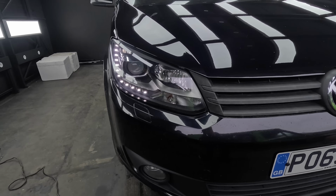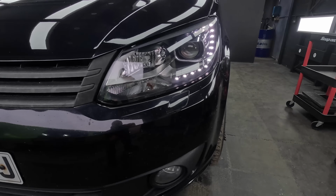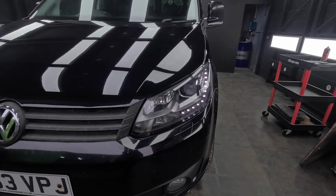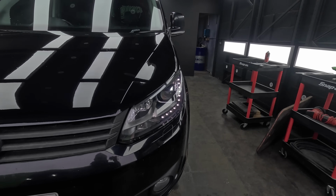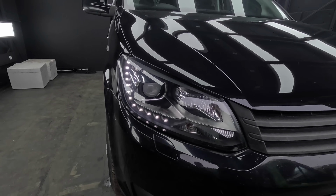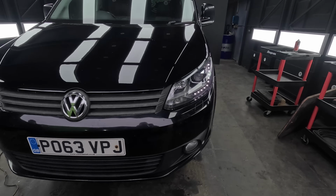Got to let the clear coat cure for a while before you cover it up. Even though it's dry and what have you, it still vents solvents. I always advise people, don't coat any of your new paint for 6 weeks till it's fully vented. 6 to 8 weeks is always a good recommendation.